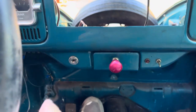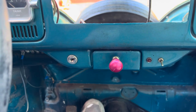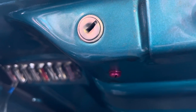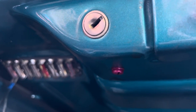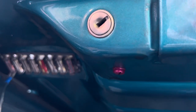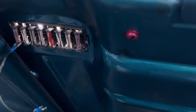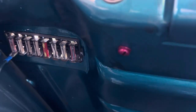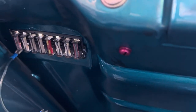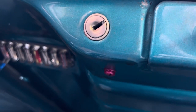So let me just turn the car off now — there we go, car is off. Now we're just going to go ahead and replace this ignition switch and see what the difference is. This is pretty basic. If you've worked on bugs for a long time, you know it's just one screw. I just wanted to show you guys this cool fancy salmon-colored screw. We're going to take that out and replace it with the new one.